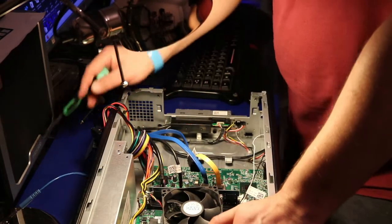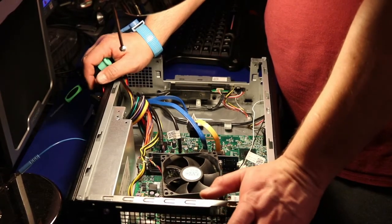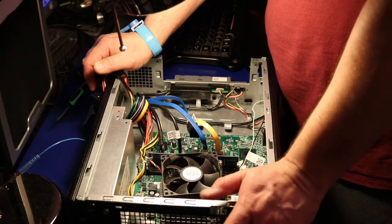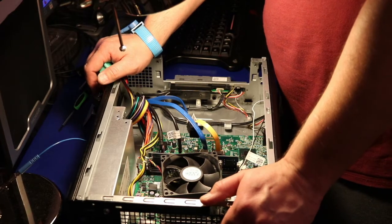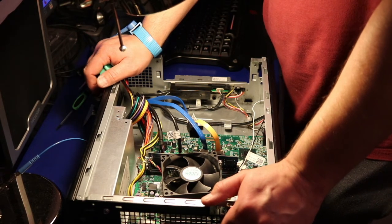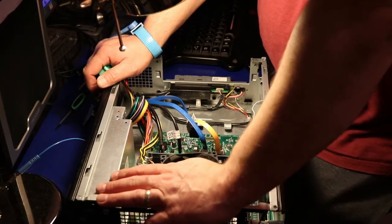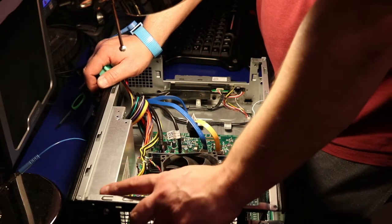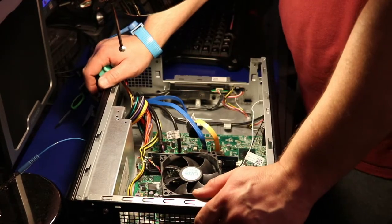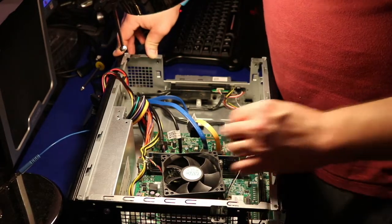Okay guys, one mistake I've done here, I should check the power supply first before I actually put everything into the case, because even though I know it's brand new, in some cases they just don't work, so I have to replace them. Then you have to unscrew everything again, and you've got unnecessary work. So the best option is to check it first. But I do believe that power supply is working, because those guys who are sending me parts, they always check them. So should be okay.